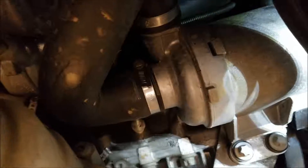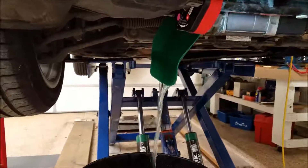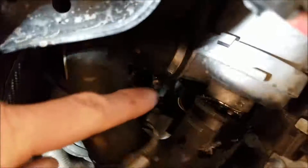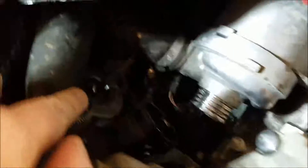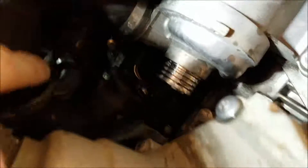Got that power connector off, and now I'm going to undo that 6mm hose clamp and let the coolant drain. Cracked that hose open, pulled back the clamp — here comes the coolant. So here are the new parts while I'm waiting for that coolant to finish draining. Now that I have that first line out of the way, I can see the other feed line — I guess that's the output line. The one I took off is the input line.